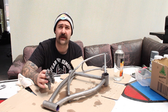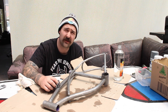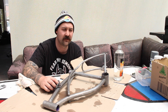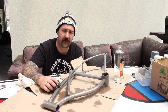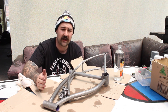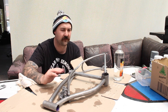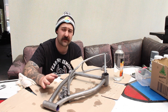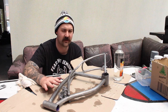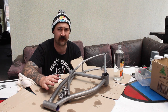It makes a big difference when you get into putting the turps on with the steel wool. It takes off all those extra little bits of undercoat or paint that the paint stripper didn't quite get to — the stripper has loosened them up a lot though, so they come off fairly easily. I don't have my gloves on anymore, but between our different coats of stripper I've been over to the tap, washed it off, and dried it — done that about three or four times. So there's no paint stripper left on the frame, and I'm just making sure I wash my hands as soon as I'm finished here.